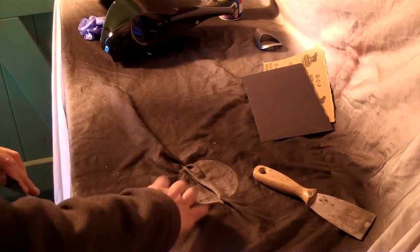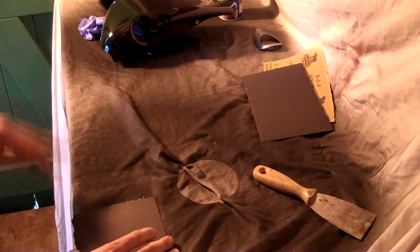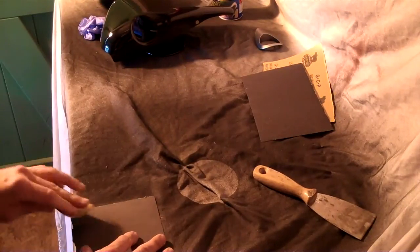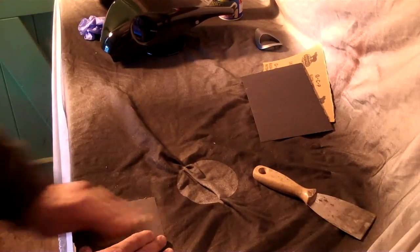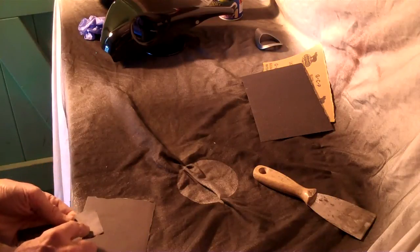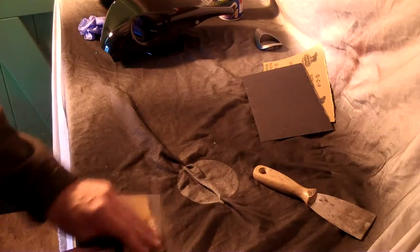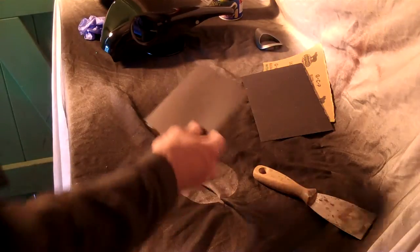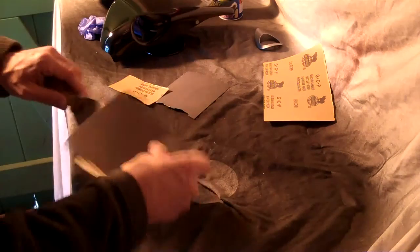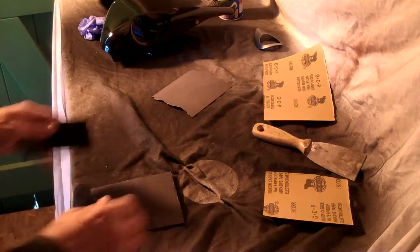We're going to wet sand these to get a nice usable finish — take out those little dimples that the rust specks made. We're effectively treating that as an undercoat, which is cool. That's now about a 1200 grit paper. I just need one more piece — one for each panel. When you're using them wet they last for ages; it doesn't clog up because it's nicely soapy.